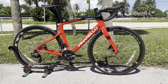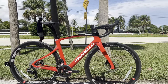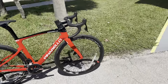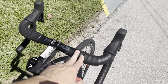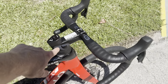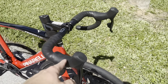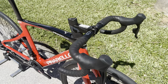Let's jump into everything that comes equipped on this Pinarello X3. You can even see that top tube — it does have a little bit of that top-end bend to it, similar to the Gravel, and they add those characteristics to help with vertical compliance. Starting off with the handlebars, you're going to get a lot of their Most equipment. We have a Most Jaguar Aero handlebar with a nice flat top for ergonomics and comfort, an alloy bar and alloy stem with the Most stem as well, and the same spacer system you'd find on the Dogma. The cables are integrated, so the brake hoses run through the handlebar, through the stem, down to the frame, and all the way throughout the entire bicycle.